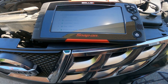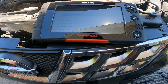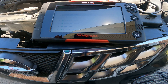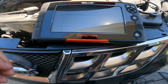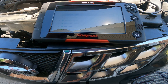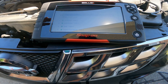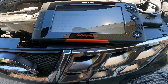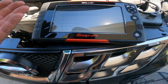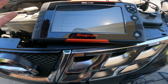What I did for the customer was take the sensor out, cleaned it with mass air flow sensor cleaner, put it back, and the code went away for a little while but then came back. So what I want to see is whether there's some kind of data that's incompatible with the computer — that's the problem with non-factory replacement parts. There may be a slight resistance variance that the computer interprets as an actual problem.